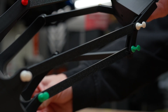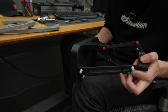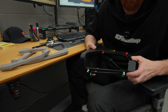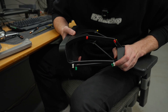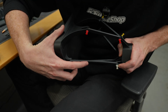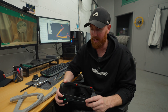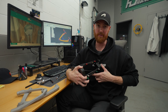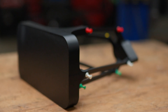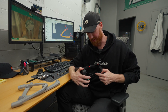It's really interesting to see when you actually start applying loads to this. Even with the thumbtacks, you can actually push on it super hard and nothing happens. But what is interesting is when you do apply any load to it, you can actually see which arms are taking the brunt of it. It's this toe arm right here — this toe arm flexes and bends a lot. The E90s have a horrible problem where they break the toe arm mount off the subframe.